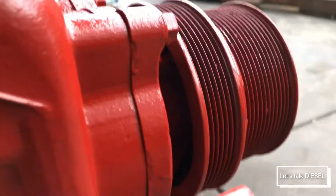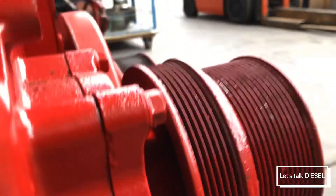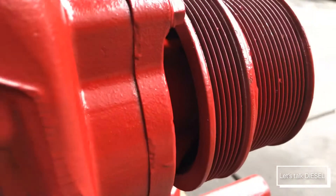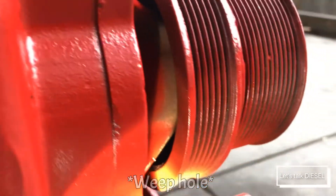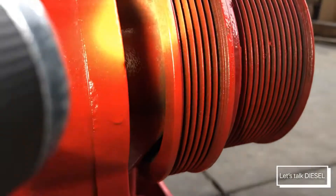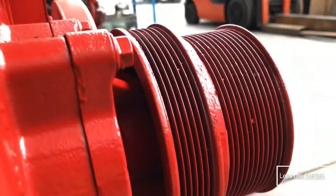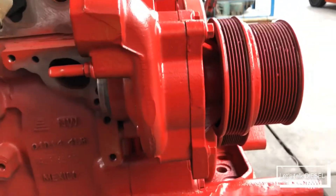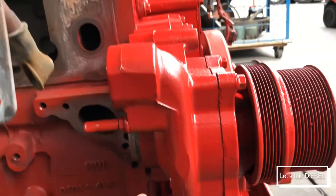Right now we're gonna take a closer look at the back of the pulley. By experience, I know that the back of the pulley always has a small hole — some kind of breather hole. Usually water pumps leak from there. If you see any stain behind the pulley, it means it is time for you to replace the water pump.